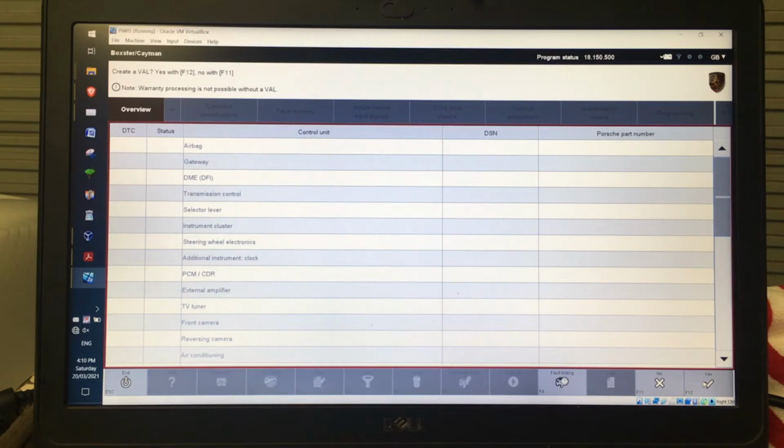And once it's done that, then it'll say, hey, is this the correct VIN? You check the VIN, say yes, and you confirm this is the correct VIN, and then once you've done that, that'll be written to that spot that I showed you before for the vehicle analysis log. I won't do that for the moment, but it's a pretty simple process. So now it's going to go and find each of the control units.